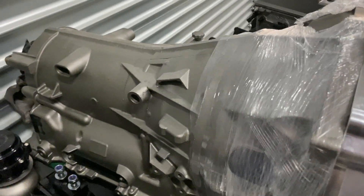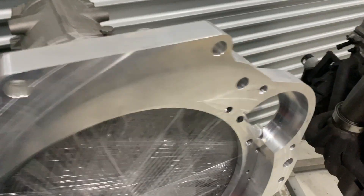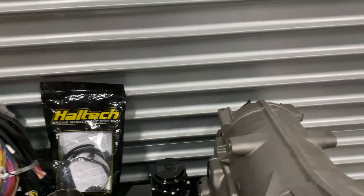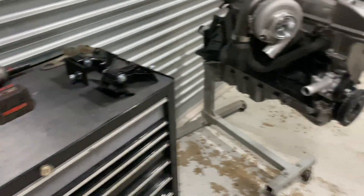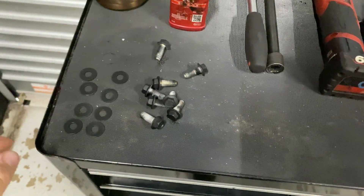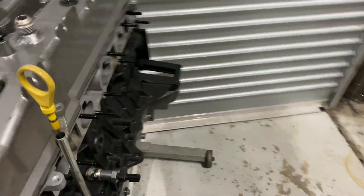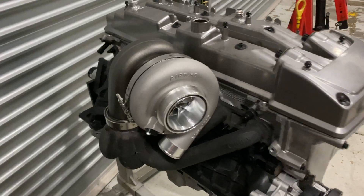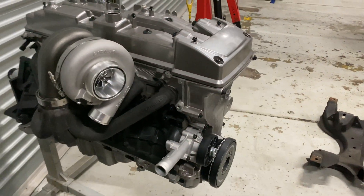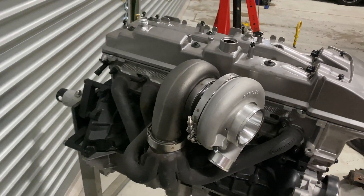This box is just a case at the moment. I have to make the car fit the box and the box fit the car. I'm going to trim a couple of these nubs off for clearancing issues into the tunnel and then maybe a few other bits and pieces - we'll see what we can get away without losing. I'm going to make a start getting this ready to go on the K-frame to go into the car. These are all the OE bolts, sandblasted and painted the heads black, with some washers to go behind them. These are the Tough Mounts and they will screw straight onto the side of the block at the location of the factory position.